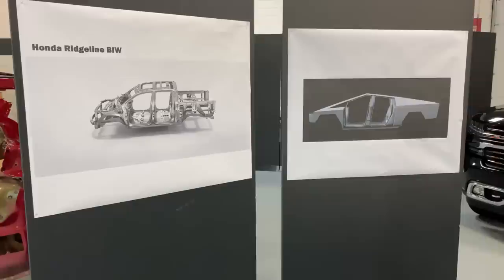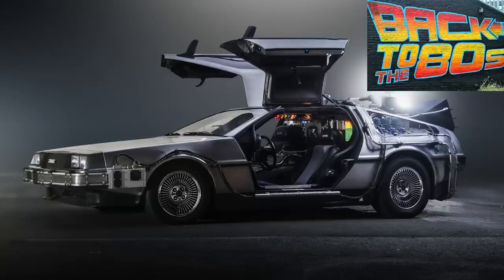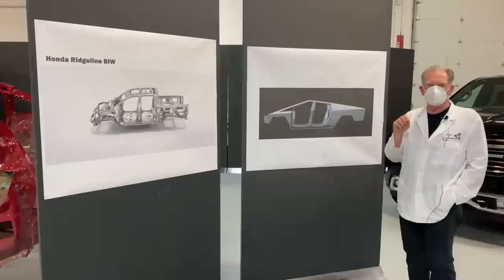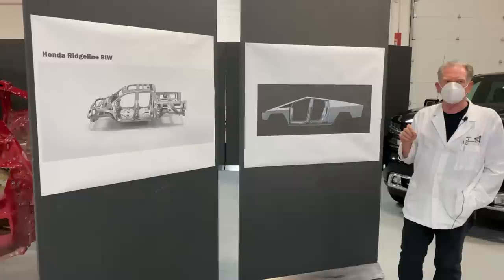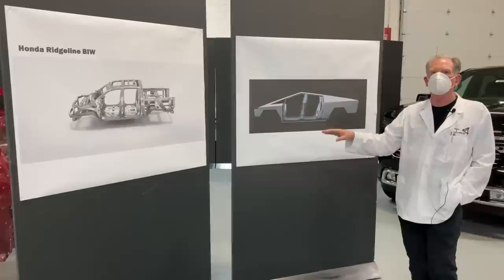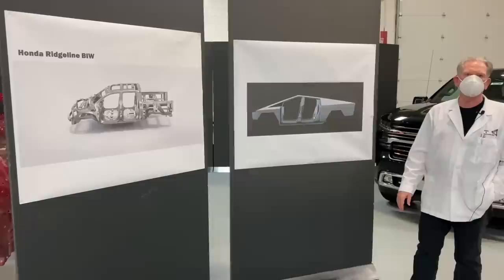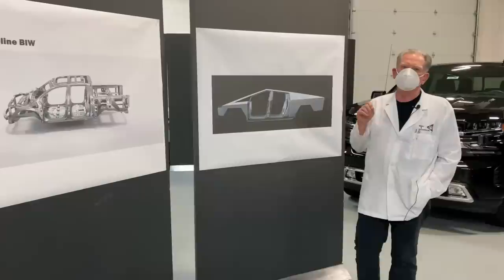This isn't the first vehicle to use stainless steel — the DeLorean famously did in the 1980s. It initially started with styling similar to the Cybertruck, but they placed thin stainless steel panels over an endoskeleton, often with a plastic backing. It was a disaster to manufacture. I actually worked on the DeLorean at the end of the program, and it was a miserable experience. DeLorean went with stainless steel for the same reason we see the Cybertruck use it: to eliminate the $500 million-plus cost of paint.